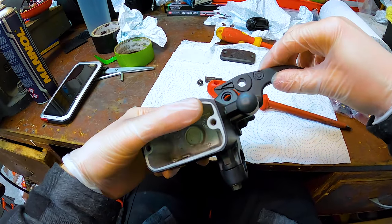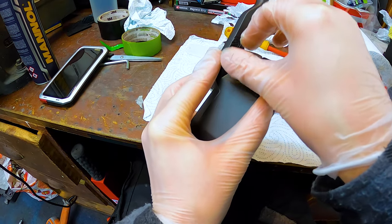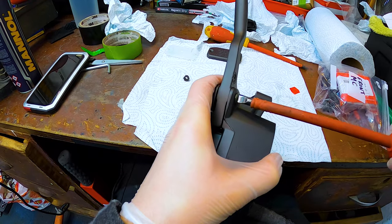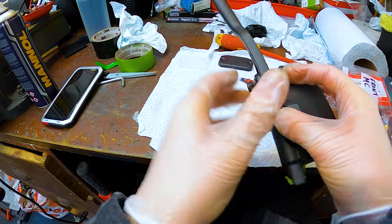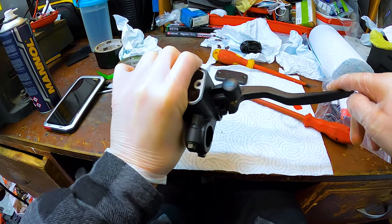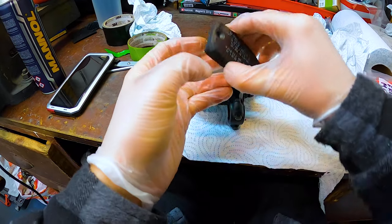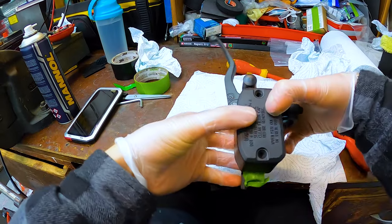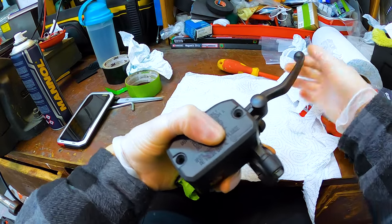It doesn't feel like it wants to stay in place, but when the lever's on it does put pressure on that pin and it kind of locks it in place. All back in. I'm going to grease this bolt up but just for now I'll stick that in like that. I'm not going to tighten it down much for now because it's going to need some grease on the inside of that — it's as dry as a bone. I can't remember where I put these bolts — I'm going to have to order some new ones annoyingly — but that should be it, ready to put back on the bike and obviously start bleeding the brakes.